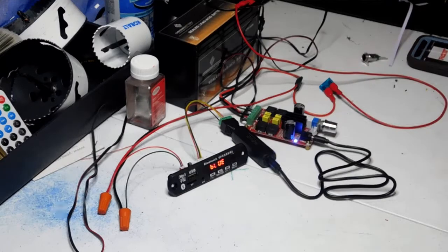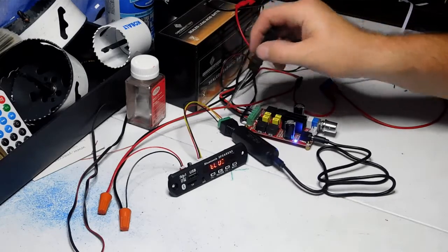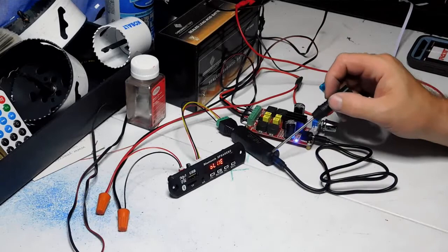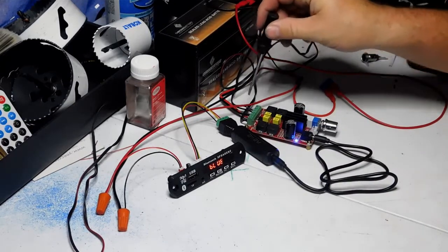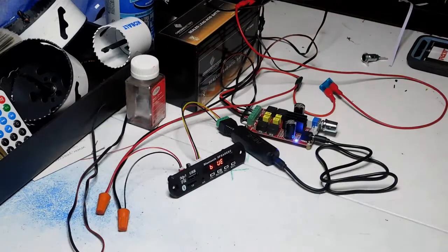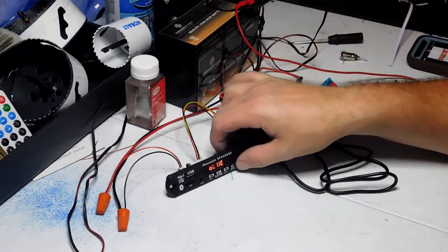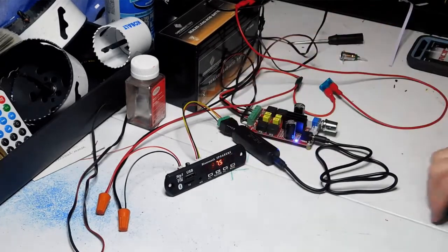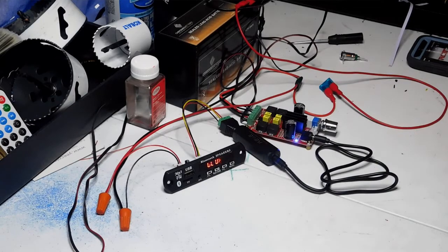You can see the wires coming out of the radio decoder into the connector, then through the ground loop isolator and into the amplifier. The speaker wires come out of the amp and the power wires go to the battery. If we had an antenna hooked up you'd connect it right here for FM radio — we don't have reception right now because the FM antenna isn't connected.